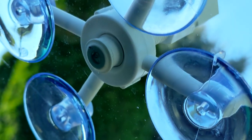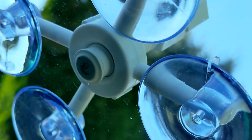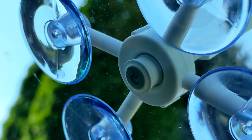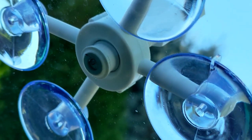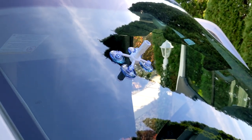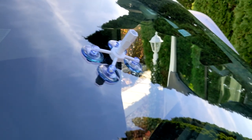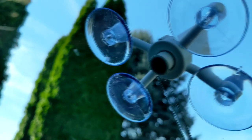Right there - there's a good angle. See that little bubble trapped in there? Some of the chip has already disappeared - some at the top you can still see a little bit showing. At this point we wait, then unscrew, let that air out, and do one more push with that little pusher. You unscrew the pusher, let the air out, and re-screw it for a few more minutes to let the resin push all the way into every last bit of that cracked chip.